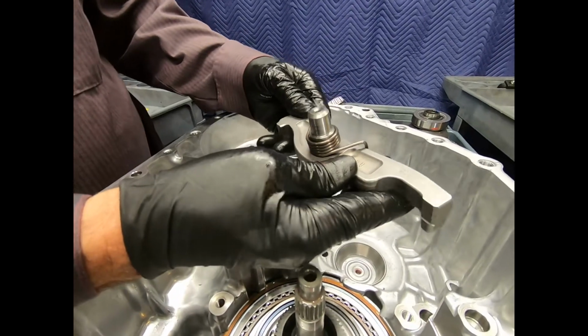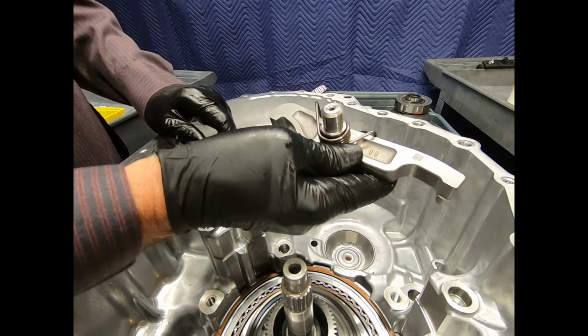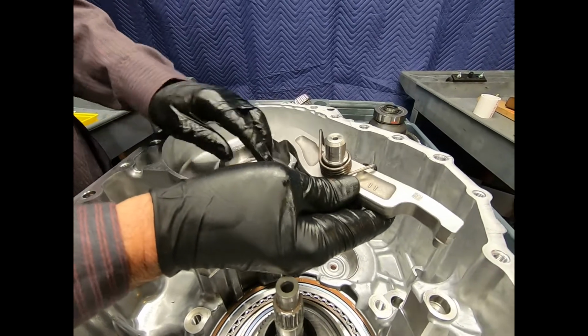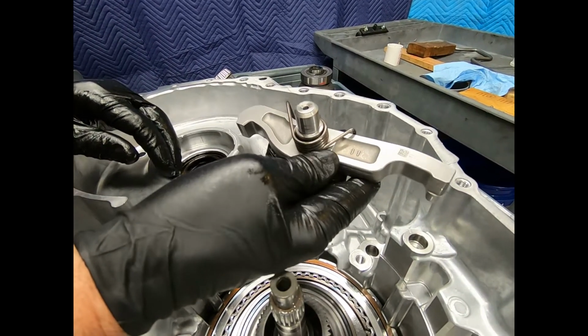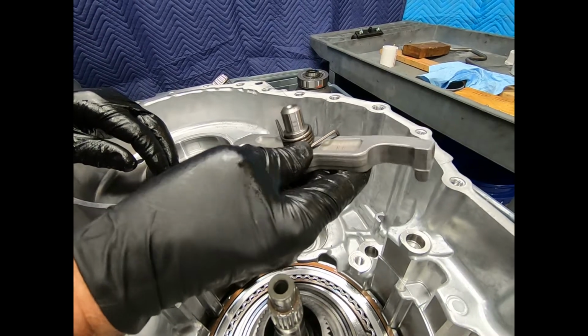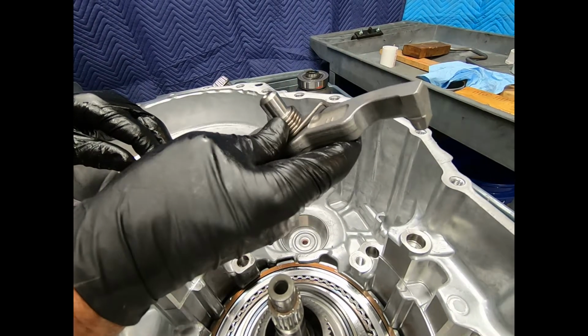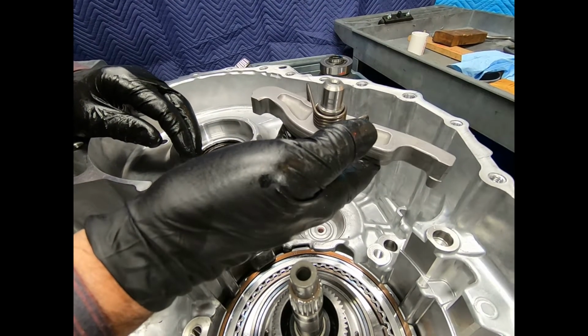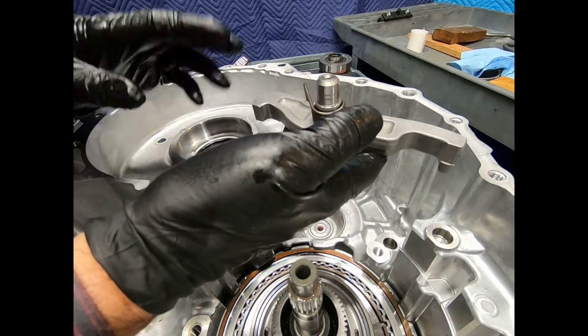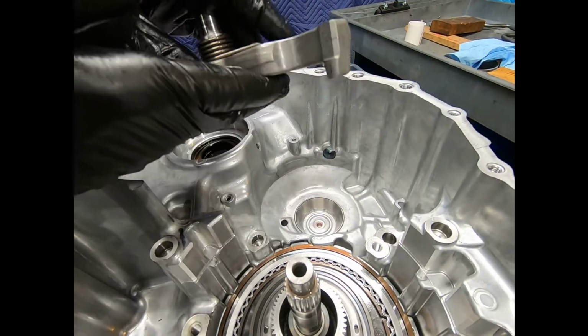there couldn't be anything more important, because as I place the transmission in park, I'm expecting the parking pawl and the parking gear to hold the vehicle in position, even on a steep incline. I know the owner's manual recommends using the parking brake, but come on, a lot of owners don't even know where it is or how it's used. So this could not be overemphasized.